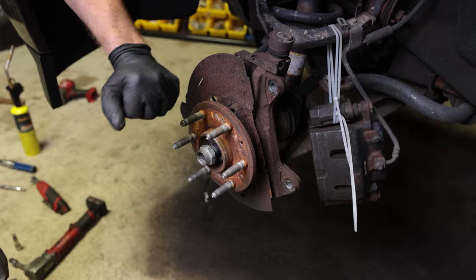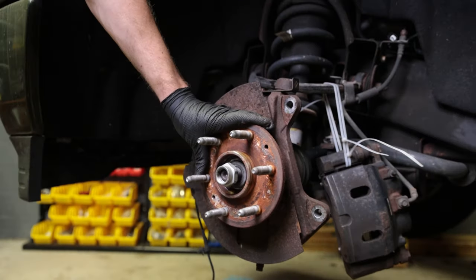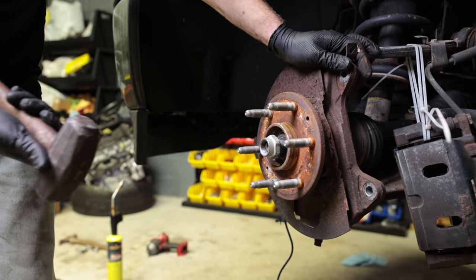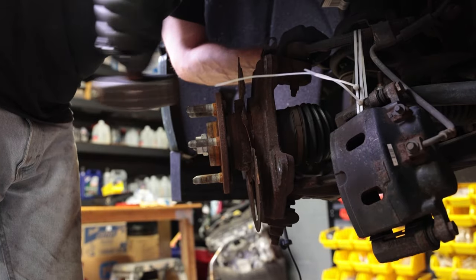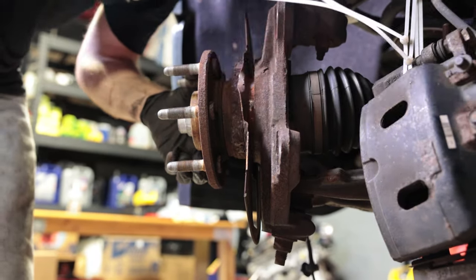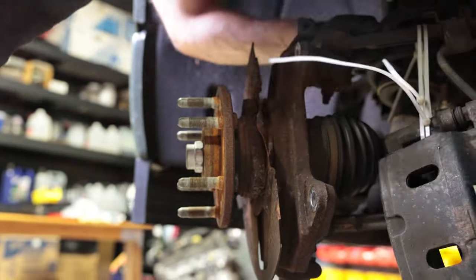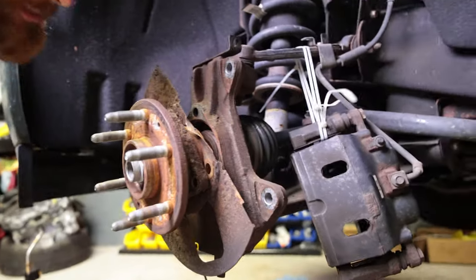Now this is another good moment for earplugs — we are going to hit this off with a mallet. If you have an air hammer, you can use that as well. On Pete's truck each one of these took about 8 to 10 minutes of beating to remove. On the other side it only took me about 30 seconds to a minute — but this is a 2014 versus a 2004, so 10 years less of corrosion. Make sure you wear some eye protection while doing this. Starting to have a little gap there — you can start to see some silver showing through. And as you can see, this is why it's a good idea to have the nut on the end, because if you give it one good whack it's going to come fly off and land on your foot.